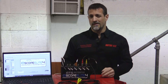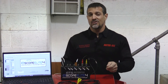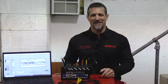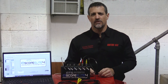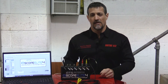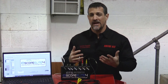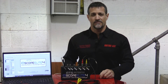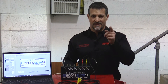When I'm talking about response, I mean the work that's actually being performed in the circuit. Think about asking your child to clean their room — that was the command being issued, but check back an hour later and it's still just as messy. The command wasn't carried out. So many technicians are concerned about the voltage available at a specific test point on a circuit. Although that's a very important aspect to measure, we have to consider that voltage is a command being issued to allow a circuit to function, but it doesn't mean that the circuit carried out that function. Stick with me through this episode and find out how measuring the work being performed is going to take your diagnostics to the next level.